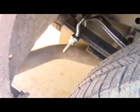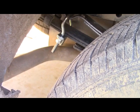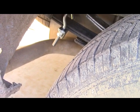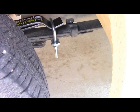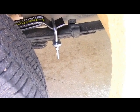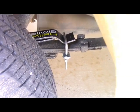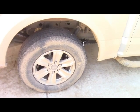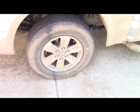Okay, so here we are on the passenger side. I am going to have to cut it off because you can look down there. You can see that the one bolt is only about 1/8 of an inch above the muffler. The inside bolt, the outside bolt's got plenty of clearance, but I'll ride around with those for a couple days and I'll cut them off. Now let's take a look at the front one up here. Plenty of clearance in there. They're snugged all the way down, as much preload as possible, so I'll cut those off as well. The ones on the U-bolts on either side of the hat, they're not a big deal, so I'm just going to leave those where they are. So there we go. Quite pleased with the installation. Very easy to do. Just recommend using power tools next time. Thank you much. Take care.